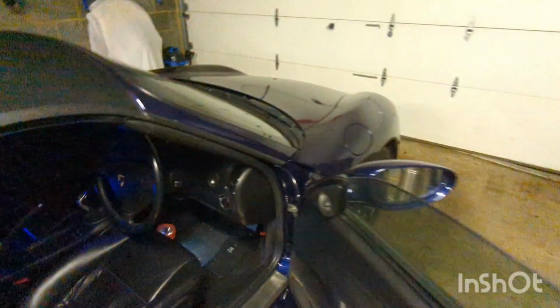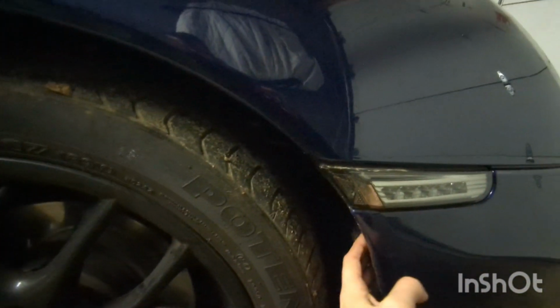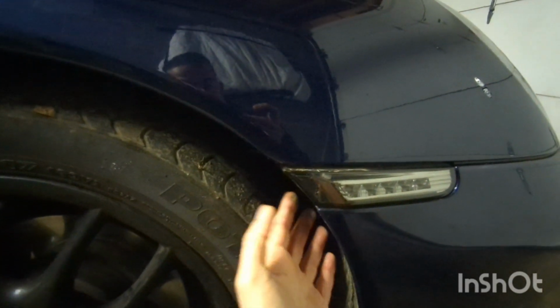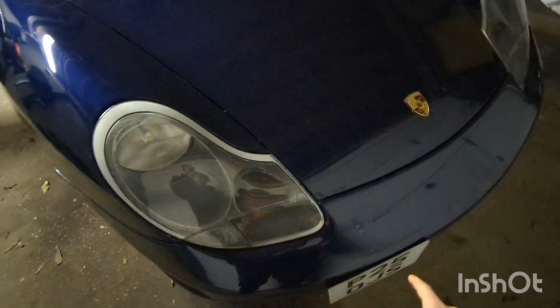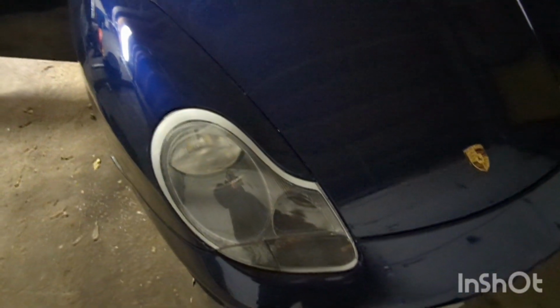The other option you have is the standard location, behind this headlight, underneath it. Down there runs a steel cable that you can pull as the emergency release. You access it by going through this wheel cover. If your locking wheel nut is in there, you're not going to be able to take the wheel off, so you're going to have to do it with the wheels turned as best you can, and frankly it's a pain in the butt. However, a lot of people who have bought these realise previous owners have placed the cable behind the tow eye hook for easier access. That makes a lot of sense.